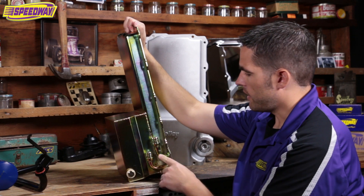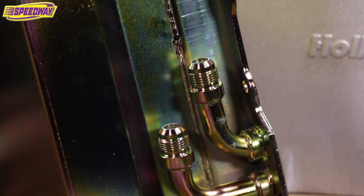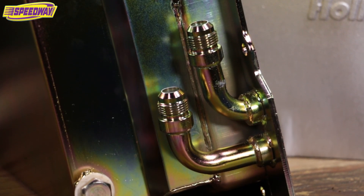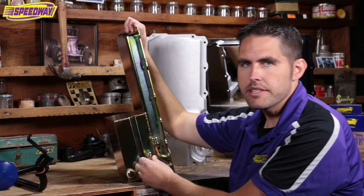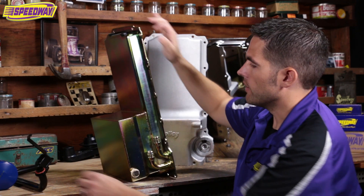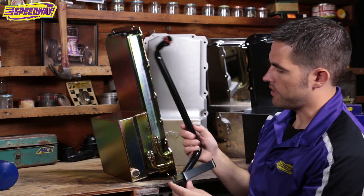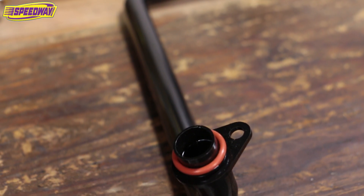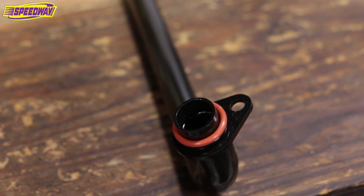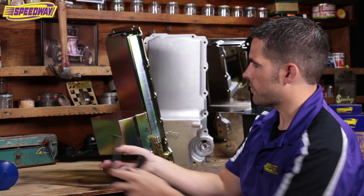It does come with a filler plug, and since it has a remote-location oil filter, it also comes with a couple of big 90-degree elbows — these are AN10. So you'll want to pick up some AN10 push-style fittings. The oil pickup is a separate piece and has an O-ring just like the GM unit. When you go to put these in, use quite a bit of oil — don't be stingy. Otherwise these O-rings will tend to rip and cause all sorts of problems with your oil pressure.